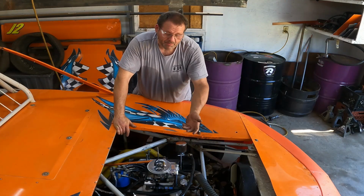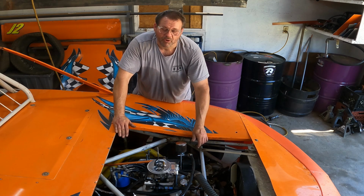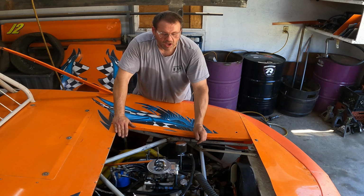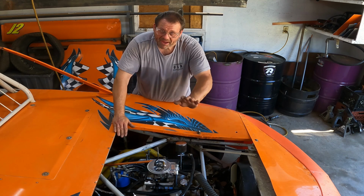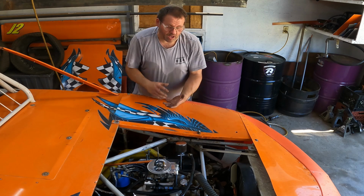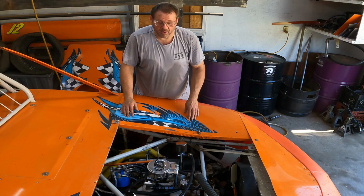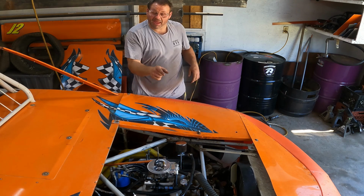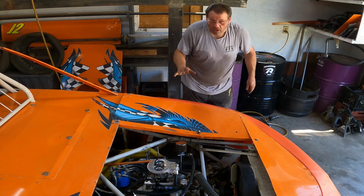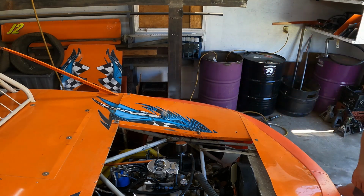Here, and it looked like to me that it would only come up to about 6 pounds, a little bit past 6 pounds of fuel pressure is all that gauge would show. So just to make sure we're not missing anything, I'm going to drop another fuel gauge on that's off of my diagnostic fuel gauge. I'm going to drop it on right quick, and we'll make a comparison and make sure it's not that gauge as well. Throwing us a little something else, another gremlin in the game there.